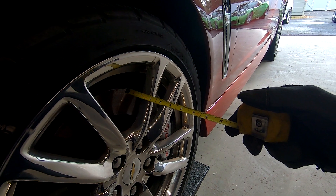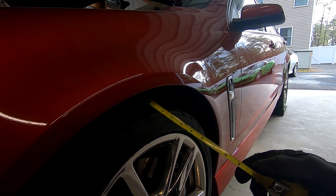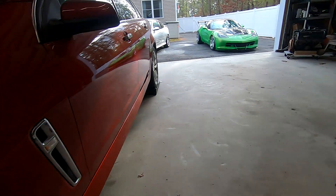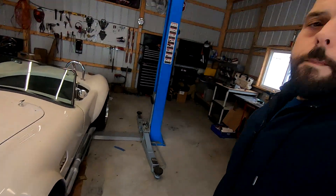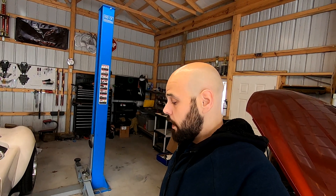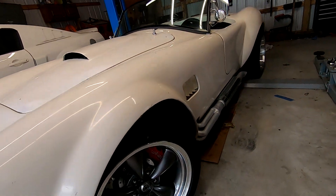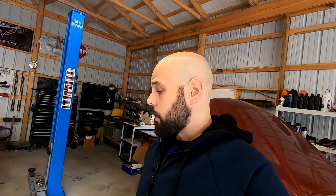If I have less clearance I would have to run a wheel spacer, and that can get tricky because then you have to worry about tire-to-fender clearance — you might interfere with your fender and damage your paint. Over here on my Cobra, these are 17 inch rims and I had a tough time getting Brembos behind these. I only had about an inch and a half of backspacing, so I ended up having to go with Wilwoods.